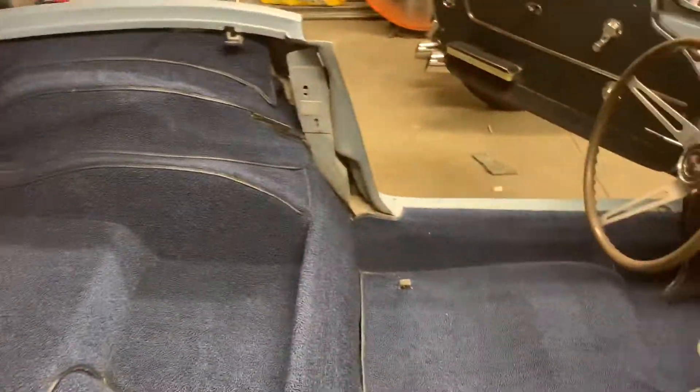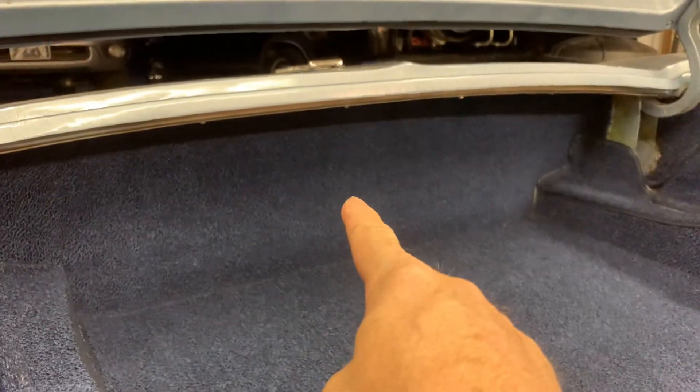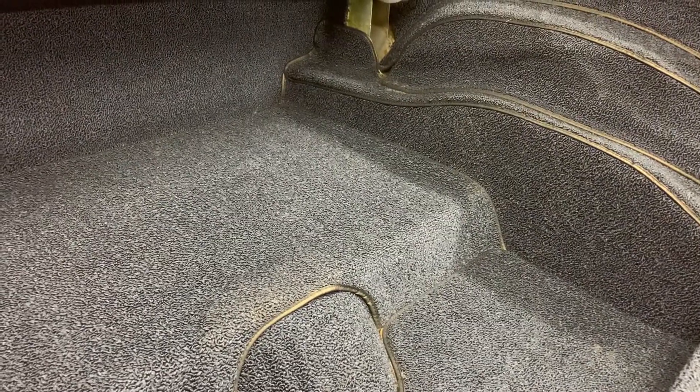I want to discuss the order of the way the pieces get glued in, because I didn't see anything on the internet about that — I had to figure it out as I went. So the order of installation: number one is the back piece, you put that in first. Number two is the divider piece. Number three is the lower wheelhouse cover, and you want the seam to follow the contour of the body — you can see on both sides how that's done. Stretch it, pull it, make sure it fits nice, front to rear, otherwise you'll have bare spots.